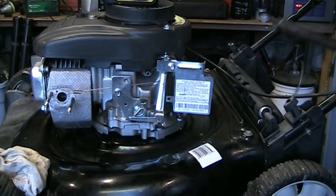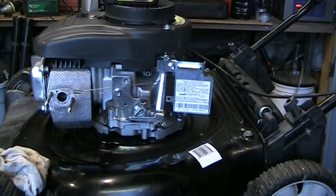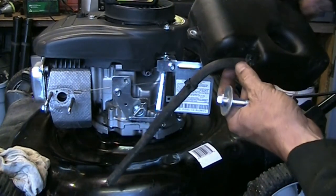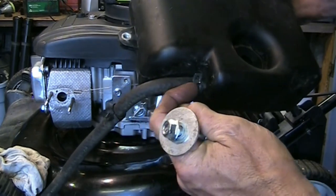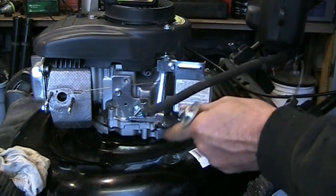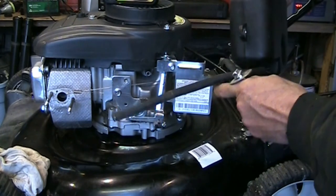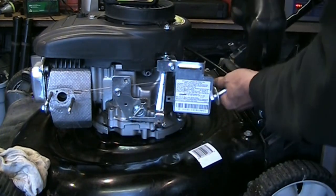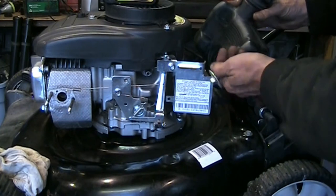While the ultrasonic cleaner was running making all kinds of racket, I took the opportunity to fire up the compressor and get that air filter blown out — might as well do all the loud things while the camera's off. In the meantime I also pulled the fuel tank off and cleaned it out. Inside, if you take this hose off there's a little insert that goes into the plastic — pull that out and it's a little fuel filter. I could feel a restriction in the line. Usually there's either an inline filter or no filter, but this one had one, so it's back together.